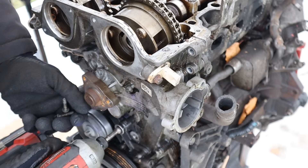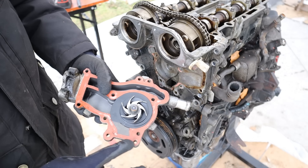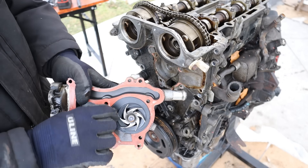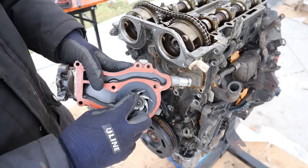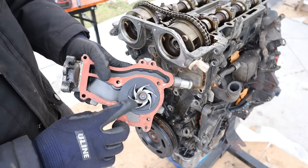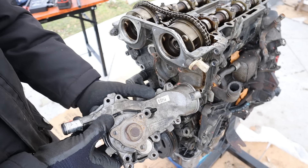A bunch of E10s, and pry this off. So unless this pump was replaced before, there was actually no gasket behind here — it just used a red kind of RTV. I also noticed this washer behind here is a little loose. What's interesting to see is that it's using a metal propeller. A lot of vehicles nowadays use plastic propellers, so that's good to see. This pump does say GM on it, so it might as well be the original.